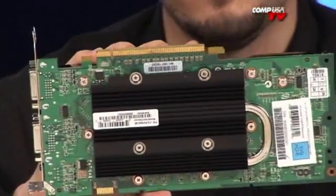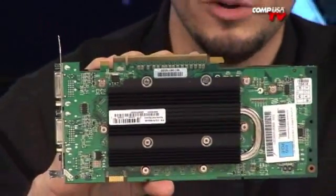This is definitely good for overclocking — that's what this card is meant for. You are paying extra, but it comes at a factory clock, so if you don't overclock, don't even buy it — you're wasting your money. Normally after the tour we'd go to benchmarks, but we're not going to do that. It's an 8800GT — you know what it benchmarks at. It will overclock a little further than the 8800GT, and an overclocked 8800GT 1GB will be comparable to this. What you get with the Akimbo version is the extra cooling. That's all it's about.